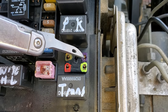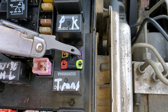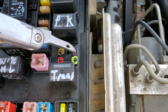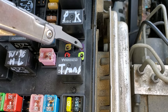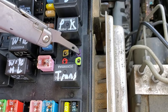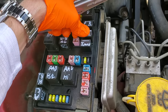You can apply your own power here as a way to test the starter. Just be careful to make sure the car is in park and that nobody's hands are anywhere inside the engine compartment. Applying power here should result in the engine turning over, assuming the starter is in good condition, your battery is in good condition, your engine is not locked up, and the wiring is good. It's not a permanent solution — it's just a way to get the car going temporarily or to troubleshoot the starter circuit.